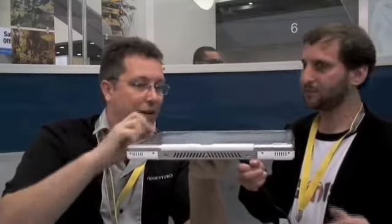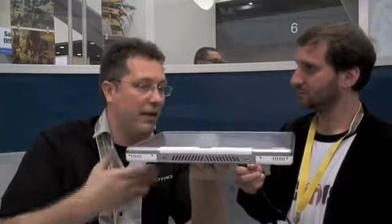This is a take-apart version, meaning the top section is going to come off. Let me demonstrate what we did here. One of the key challenges we have with our Modbook is that it's a half-body design — we built half the body and the other half comes from the base system, in this case the Apple MacBook. That means our top design only works with a specific bottom design, and if that product reaches end of life or gets terminated, we don't have something we can attach it to. It also means we're restricted in what we can do — we can't build the best tablet. What we can do is turn an existing Mac into a tablet, but it's not the best tablet I can build. For example, the pen is on this side not because I like it there, but because I had to — I didn't have space anywhere else. So now we're changing to a multi-body design.